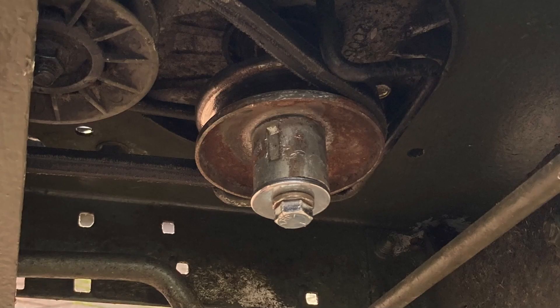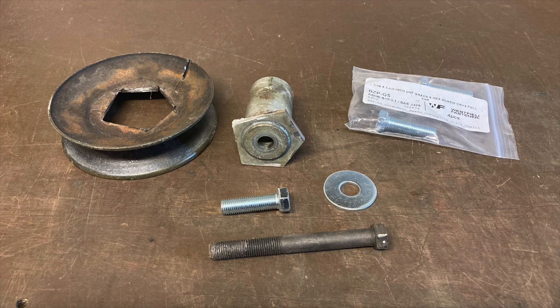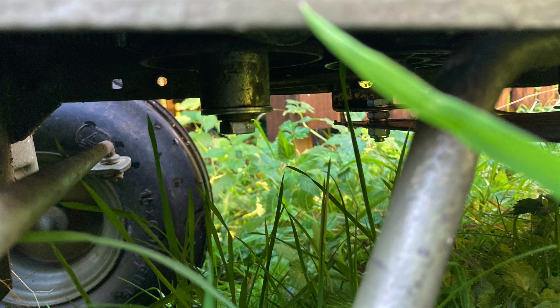I took the pulley wheels unit off and cut it down to size with a mains-powered angle grinder. To get the angle grinder right in I had to butcher the bigger wheel to get it out of the way. In the foreground is the original long bolt that held the pulley wheels onto the drive shaft, and then shorter 7/16th of an inch UNF bolts which I had to order online — you can't readily get imperial-sized bolts in the UK as we've gone over to metric. I use adjustable spanners a lot more than normal since I only have metric ones. This shows the end of the pulley wheel with one of those bolts, the original sprung washer and a new penny washer to close the tube end off. On the right you can see the end of the steel skid plate which I added to protect the drive belt. I might make a longer skid plate now to cover the pulley wheel too, now that it's shorter.